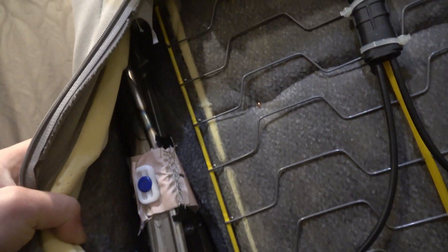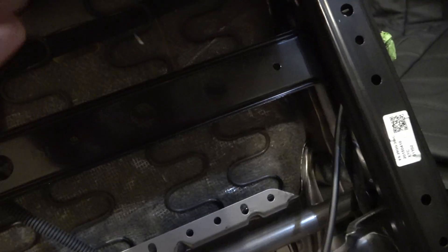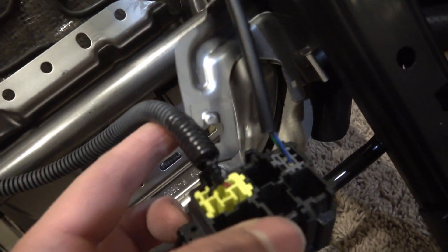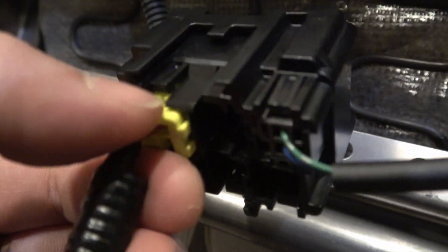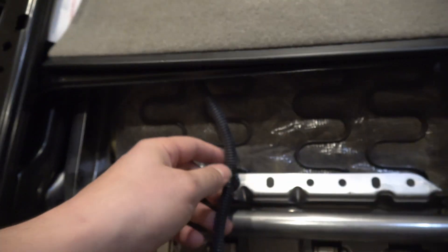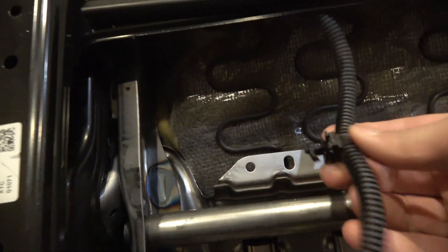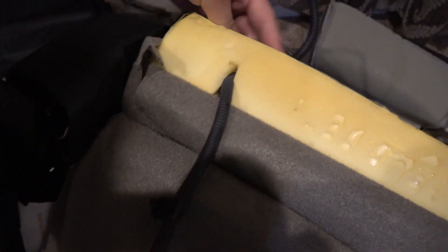I also need to disconnect the airbag on the underbody of the seat. There's a little plastic piece that uncovers and reveals your under-wiring so you can disconnect the harness. Slip it up and through, then put a flathead through the pin and pull the plug out. Then use a panel popper tool to pop that wire off and pull the bottom seat cover right off.